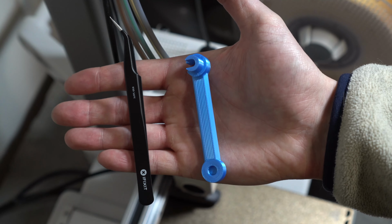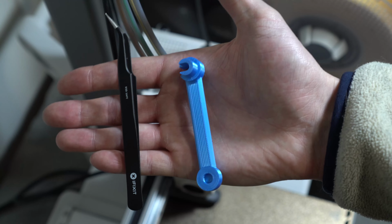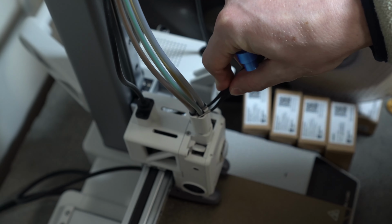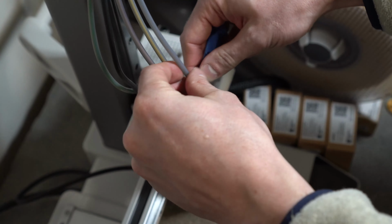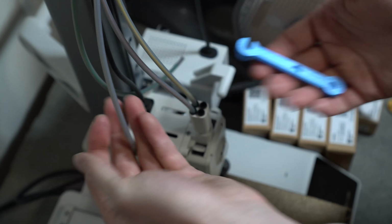Now you can either use a pair of tweezers or this 3D printed tool here. I'll put a link to both of those in the description. And what you're going to do is try and push down on the black ring while pulling up on the tube. You do these two actions at the same time. Push down, pull up, and it should come right out.